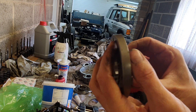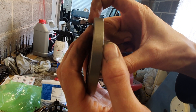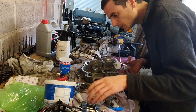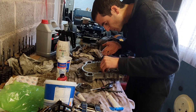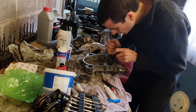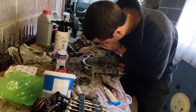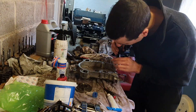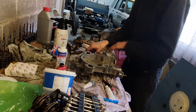It's very hard to tell on camera, but the old one has a sharp edge on the top and the new one has a chamfer on it — so we put the chamfer down. Putting lots of oil in where the oil pump goes, and putting the oil pump in. Putting the cover on with lots of oil again, and putting the screws in and tightening those down — they're machine screws. I'm checking that the pump freely moves and I can rotate it. Then I'm taking the screws out one by one, putting Loctite on them, and tightening them back down as much as I can with the screwdriver — probably more than spec, but they've got a very short grip length, so they need to be Loctited in. The manual suggests that as well. All done.